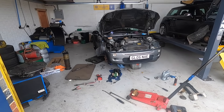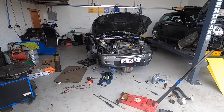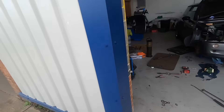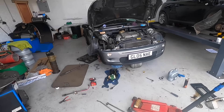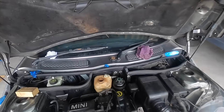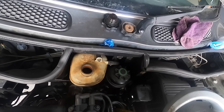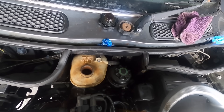I've tightened up the sump plug - we will need a new one but I only plan to use this oil for about 10 or 20 miles anyway. The thread is damaged so I don't plan to keep it on long, but for now it will hold oil. Spark plugs back on, then put oil in and start it, then order a new sump plug for next time. It actually takes 4.8 liters so I'm going to put all of this in plus a little bit more.